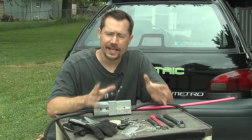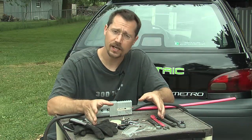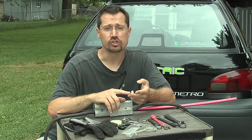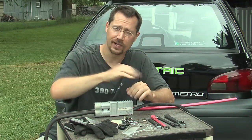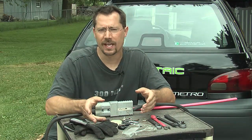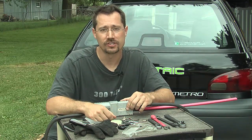Also, like working on any car project, other things to keep in mind: when you're jacking up the car, make sure to have your parking brake set, chalk the wheels, and once it's jacked up use jack stands — don't rely on just the jack itself to keep the car from falling down on top of you. Of course, follow all other safety instructions. Any manual that came with a power tool — read it and follow the safety guidelines. We want you to be safe while working on this project.